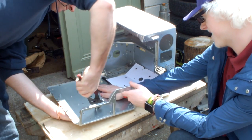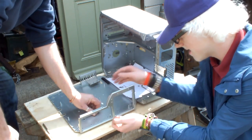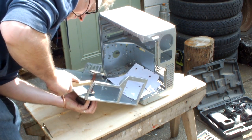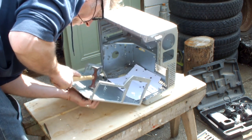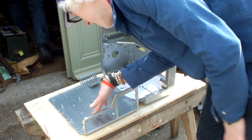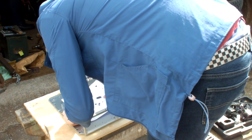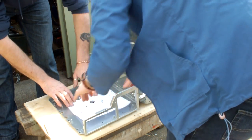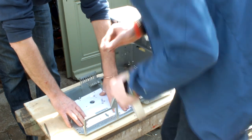We followed the instructions which said to pull off the original standoffs. For those of you who aren't aware, this is a totally non-standard case. The PowerMac G4s are fantastic cases but the motherboard standoffs and motherboards themselves - as with pretty much all Mac desktops - everything is its own standard. So none of the original standoffs are useful to us. When you pull them out it does bend the metal slightly, so we were knocking the metal back into place to make sure it was a flat, smooth surface - it's really important to keep your motherboard tray as flat as possible.